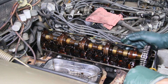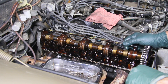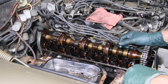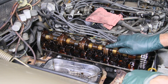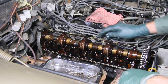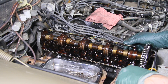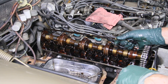These parts are probably less than ten dollars, and look at the grief they can cause. This is one thing I really shake my head about. I don't think the engineers really understood the effects of age and heat on plastic, because we're looking at engines that are sometimes close to 40 years old. The early six cylinder, like in my 280 SL, had little metal clamps. I actually thought about coming up with a kit — making a couple of little screws and taps and putting maybe one or two metal clips over the top so that even if the plastic clips get loose, this oiler tube cannot fall off.